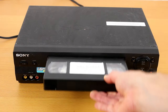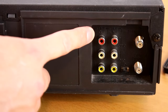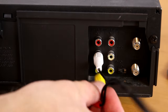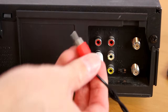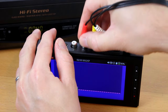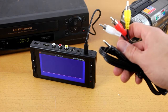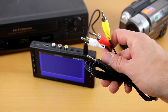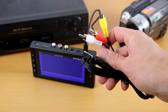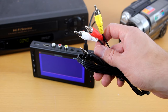We'll hook up your audio or video source. Let's cover video sources first. Plug in the included video transfer cable into the output ports of your VCR, camcorder, or other video source. Plug the other end into the video to digital converter, matching the color of the plugs to the color of the ports. Please note, some camcorders will require a 3.5 millimeter to AV cable or another specialized cable not included with the converter. Check your camcorder's user manual or contact us if you have any questions about which cable to buy.